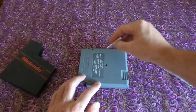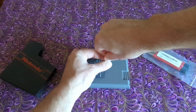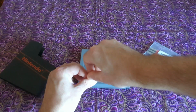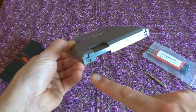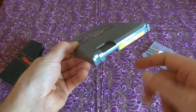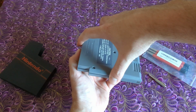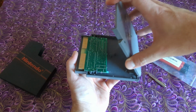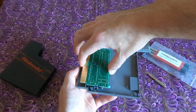And what you're going to do is you're going to open up that cart. You're going to take off the 3 game screws on the back with the game bit driver that you bought. And keep in mind, these NES carts have tiny little clips in the corners. That's how you know it's an authentic cartridge. So you're going to want to lift closer to the actual PCB and lift away at an angle. You don't want to immediately rip these things up.